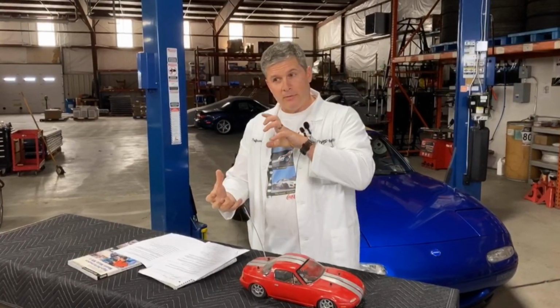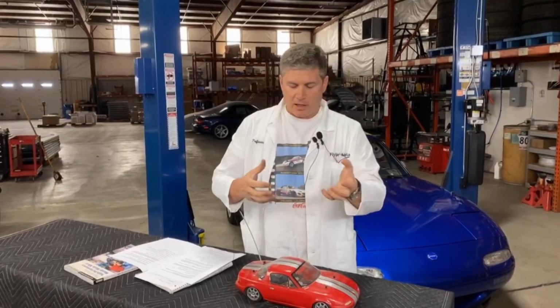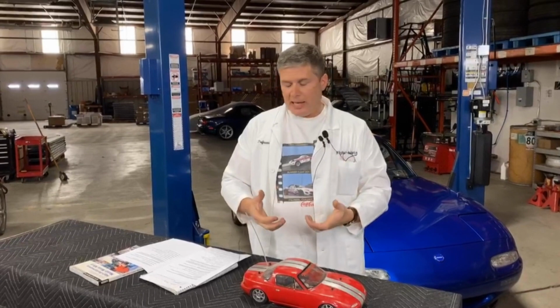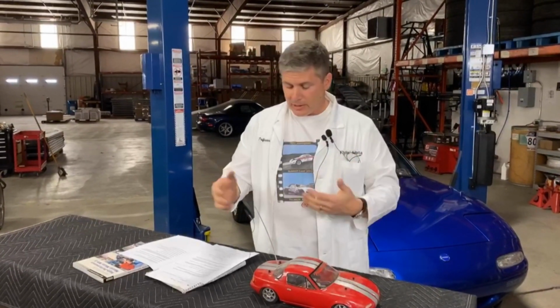It's going to increase the amount of brake torque at that end of the car. It'll add more brake bias at that end of the car. It looks awesome behind a set of wheels. It adds more unsprung and rotating mass. It can absorb more heat. Is it better or not? Well, that depends on what it is you're trying to do.